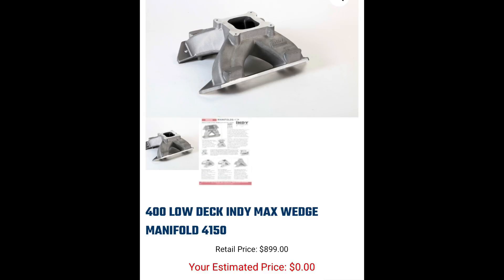Part of it's price — they do cost more than other heads. The correct intake I can find for a low deck right now is from Indy, and I believe they want $700 or $800 for it. It's going to have a taller profile. If you're trying to fit this under a car hood of any kind — like not a race car — then you're going to have problems. I did a dyno 440 for my buddy Nick, he's got a flat hood on his Charger, that's why he went with 240s. People were freaked out about it: Engine Masters shows you make more power with the 270s. I don't think anybody in the world is going to fight you about that, but what will fight you is your hood when the carburetor leaves a dent in the top.